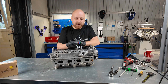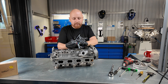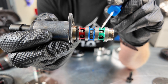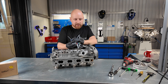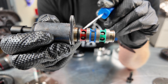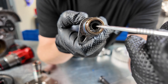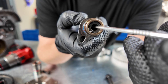Only during the activation of the variable valve timing system, when the engine control unit sends the command to switch the wheel, the oil is then redirected from the central blue section to the green section — meaning from the supply to the engagement section. This indicates the activation of the variable valve timing wheel mechanism. At that point, the intake wheel is accelerated, while for the exhaust wheel, we proceed to deliberately retard the camshaft timing by a specific, calculated degree. The red section is connected to a central opening specifically designed to function as the primary ventilation system. The used oil from the previous operating cycle is expelled each time through this opening directly back into the engine head.